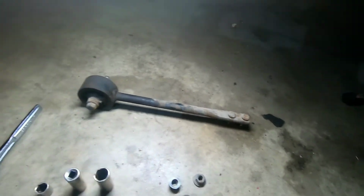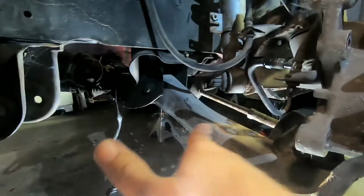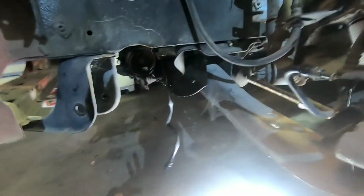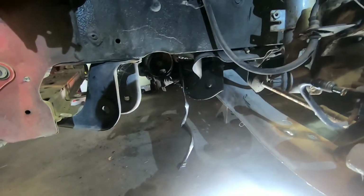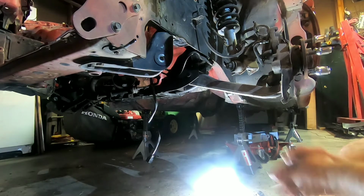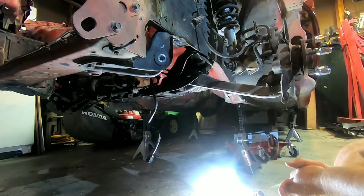That there, everybody, is the tension rod. Nothing fancy. These usually go bad, the rubbers, and people upgrade them. It is part of the lower A-arm assembly, is what one would call it. We call it a tension rod. People replace this unit here so that you can adjust what they call caster. So when you get different size tires, you can replace that. Z1 makes one that I like, that is a polyurethane bushing. That makes life a little easier. And I enjoy it, other people don't. Other people go with a lot of like Power Treks, all sorts of other different stuff. But those are mostly steel bushing, so they're pillow bushing right here. So it's really mechanical, you can get some squeaks now and then.